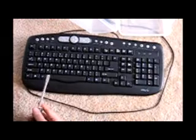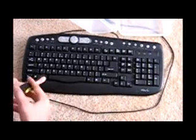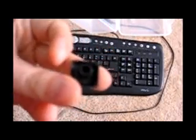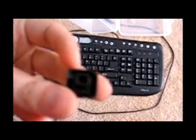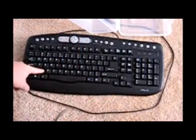I'm going to push the alt key down, insert the screwdriver gently in here — gently — and as you can see it pops right off. Nothing was broken. As you can tell, this is the letter Z, and the back side — this part actually snaps inside of this casing. I'm going to do that with the rest of them.